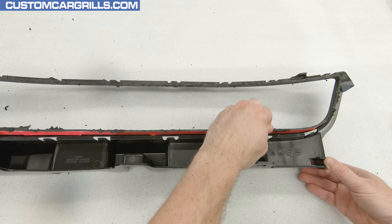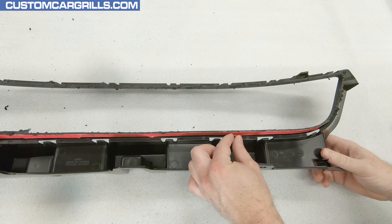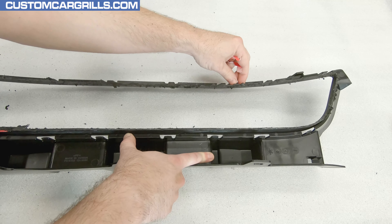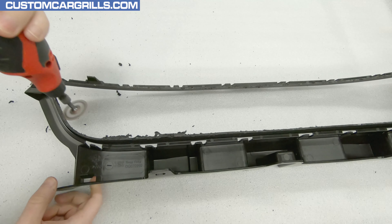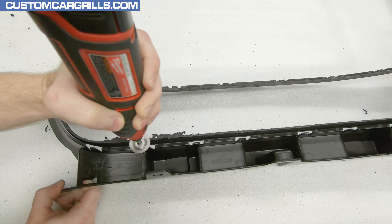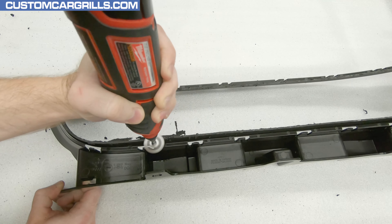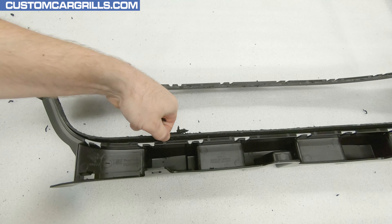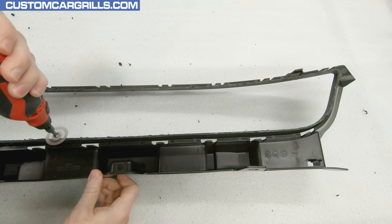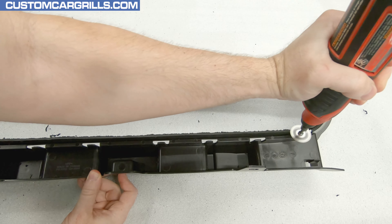There's going to be some burnt-on plastic bits that can be removed by hand after this cools down. And later, the tape line that we used can be taken off and thrown away because we won't need it anymore. If any cuts were not deep enough and there's plastic diamonds remaining from the stock grille, then this is the time to address them. The top of the shaping wheel is highly abrasive, and I can use it to slowly shave down any uneven areas. Even if there's no remaining diamonds from the initial cut, it doesn't hurt to do a couple quick light passes with the shaping wheel to refine the cuts down better.